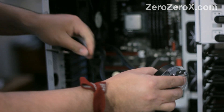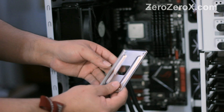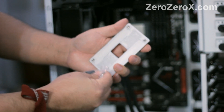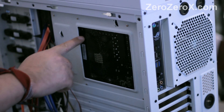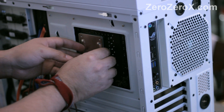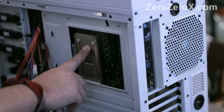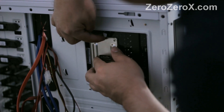The pump is connected to the radiator via these two tubes which move in any direction. The back plate will hold the screws at the other side of the board. These four screws with plastic heads go here and will hold the pump in place. On the back side of the board you have to hold the back plate with some kind of adhesive — if it doesn't come with self-adhesive, use a piece of tape to keep it there until you can screw all four screws holding the pump and the cooling plate that cools the processor.